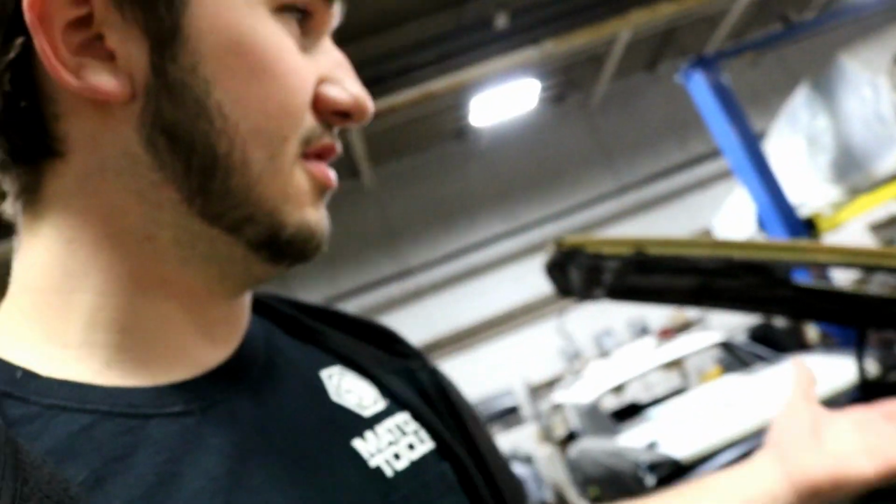Now, it's not a question of whether it's going to fit or not, because it is a 5.7, that's the same as a 350. And people have put these in here for years. A lot of people have done LS swaps in these. So it's not going to be hard for me to find the right motor mounts or exhaust to clear and fit it in here. I'm not concerned about that at all.